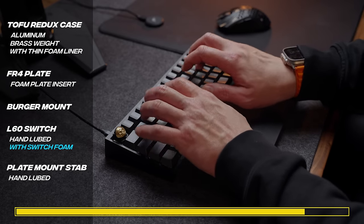Maybe it's because my switches are the very first batch L60s and they are hand lubed. So let's check out the newer batch of the L45 lighter weight switches — these are factory lubed. A little improvement, but again, not a huge difference. Wooting also includes two different dampeners — a silicone and a foam — with the new PC plate option. Silicone is supposed to mute more of the mid-tones and the foam is supposed to mute more of the high tones. The silicone for me seems to accentuate that noise, and the foam seems to cool it off, so I think foam is the only way to go.